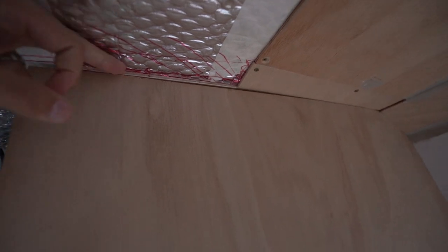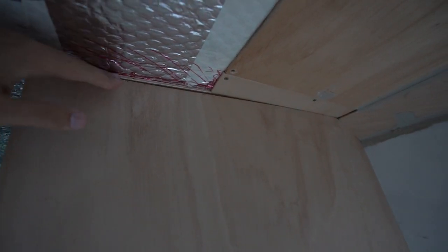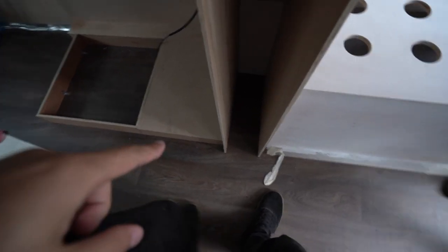We've got a shelf — it's very small but it's working. I cut the next piece and there's a tiny mistake, but the lesson is: even if two pieces of wood are right next to each other, 14 centimetres apart, you can't guarantee they're exactly the same. I should have cut it a bit longer and then scribed it. Everything else fits nicely on one end all the way up, and there's a tiny gap at the other end, but the cladding and clip things will cover it.